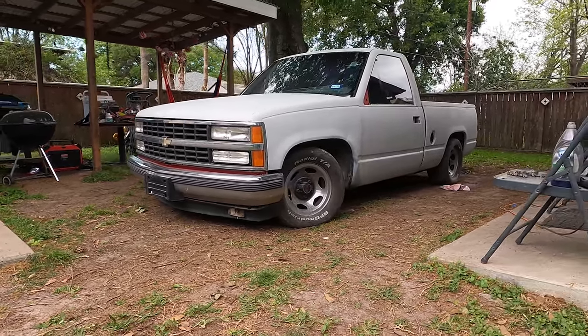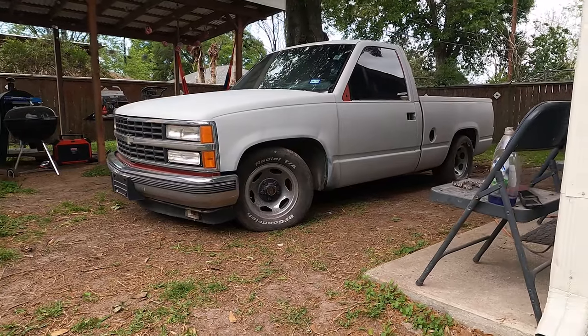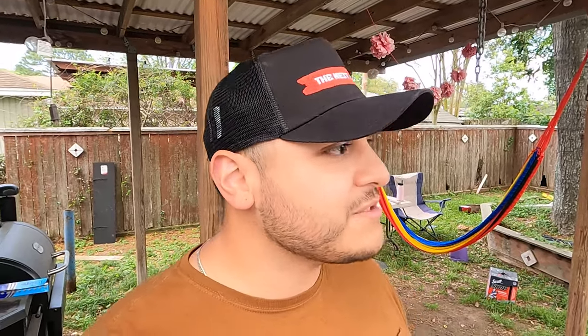Guys, so the truck is all primed up and ready to go. It came out great. I'm really happy with the results. It's not perfect. I'm not an expert, and I do have some runs here and there. That's the good thing about primer, is you lay a really thick coat and you block out all of your imperfections in the next stage. And I'll be going over that in my next video.